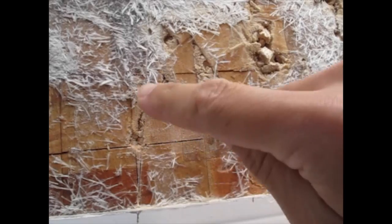And this is why water is able to get further into the core away from the damaged areas. These are the score lines in the balsa, and you can see that they weren't all filled, so that allowed water to migrate along those channels. Other than that, it was really well bonded, and you can see I'm really having to destroy it to get it out of there.